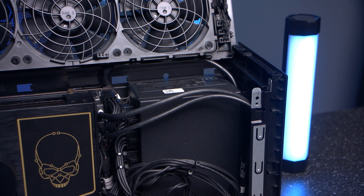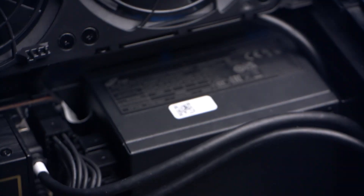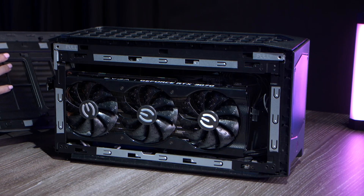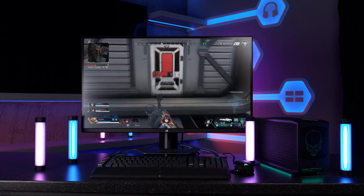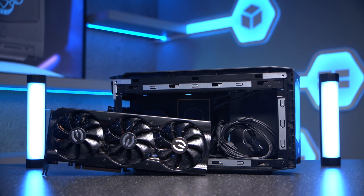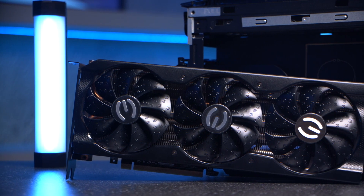Here this NUC also doesn't disappoint. There's a modular SFX power supply with a 650 watt 80-plus gold rating — enough to power a GeForce RTX 3070 Ti or maybe an RTX 3080, depending on what you're playing or if you don't mind a little undervolting. As it's an SFX model you could even upgrade it to something more powerful should you wish to. For the GPU itself, you can fit any model that's a two-slot design and up to 30 centimeters long.